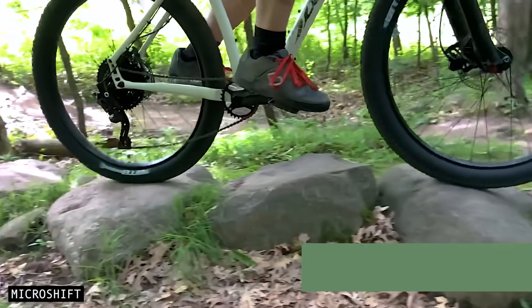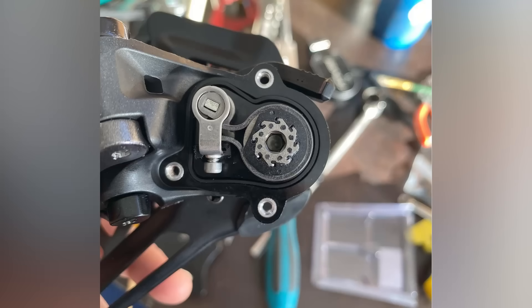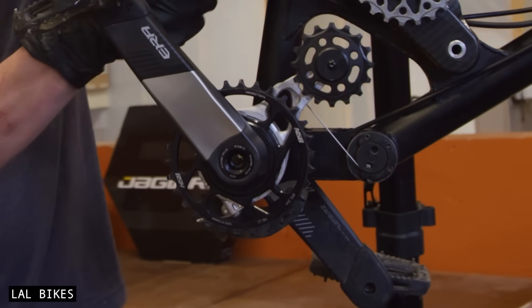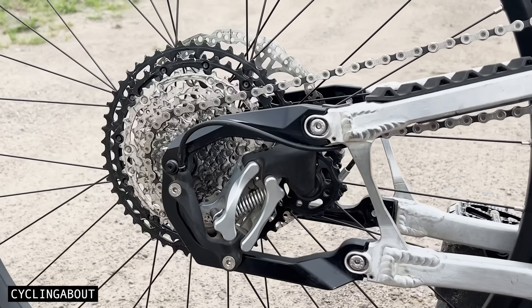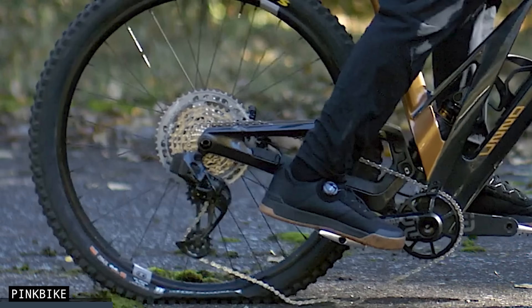In comparison, a regular derailleur uses a one-way clutch to prevent your chain from rattling. These clutches often rely on sliding friction, making them especially prone to wear. The Supre tensioner is unlikely to wear out due to its sealed, oil-damped design. The combination of high ground clearance and high chain tension under a large impact also keeps your chain from slapping on the ground, meaning your chain ultimately accumulates less grit.